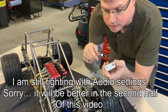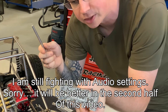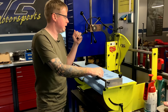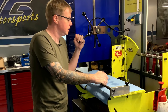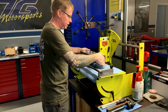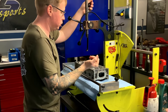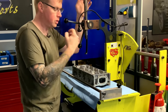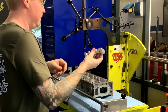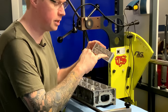Let me show you how we disassemble real cylinder heads in our shop and then we can discuss how to disassemble a small tiny thing like this. So this is the table, the fixture we are normally using to do any kind of disassembly or assembly work on cylinder heads. Normally the cylinder head goes on here, the valves are sticking out on top with the valve springs and retainers. You use this to push down the retainer to remove the valve locks and then you will be able to disassemble the valves. But as you can see, there is no possibility to do any work on this small thing. The retainers are so tiny, it is just incredible.